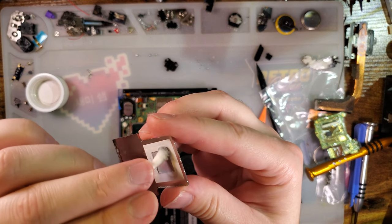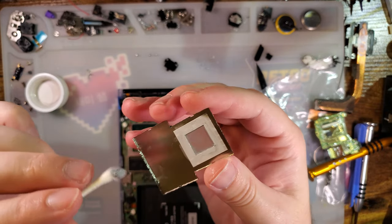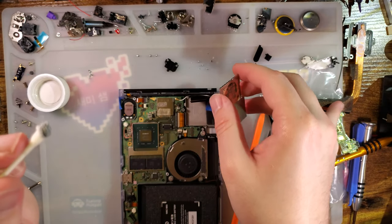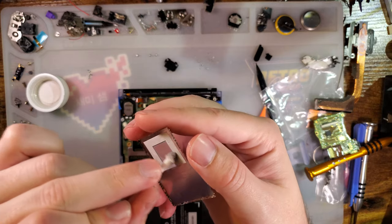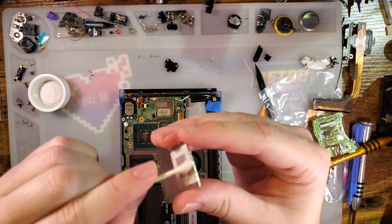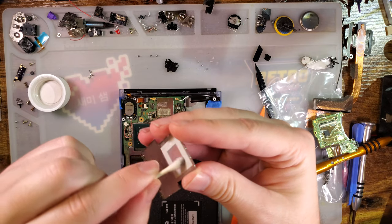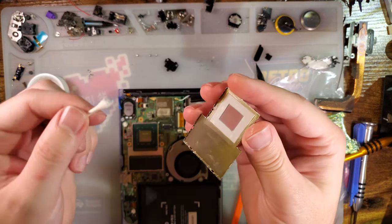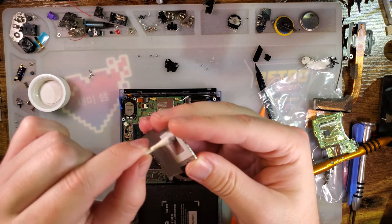I wonder if there are aftermarket heat sinks or something I could throw on this thing that replaces this stupid little copper shim with something that would have direct contact, the heat pipe. I believe it is done the way it is, not because it's efficient. It's clearly not the most efficient way to do this. But I suspect for reliability, because the chip doesn't get that hot. Like, sure, it'll get toasty at times, but realistically, it's only, what, like a 15-watt chipset or something? Even less if you're not running it docked.